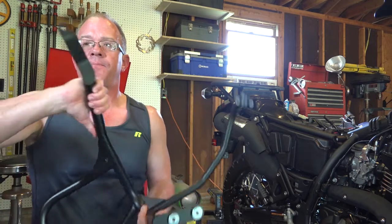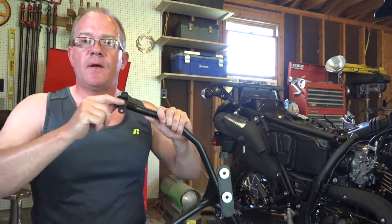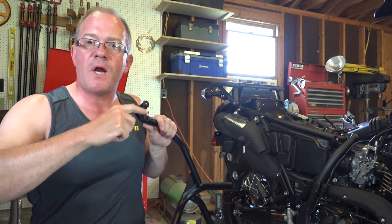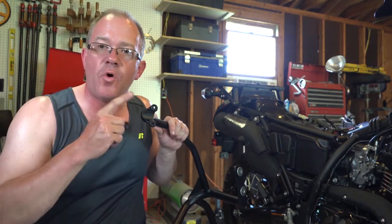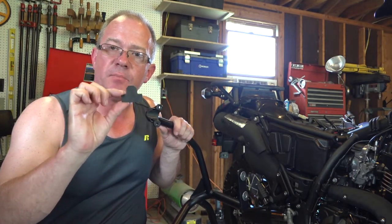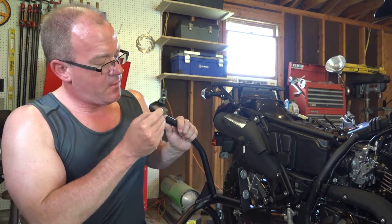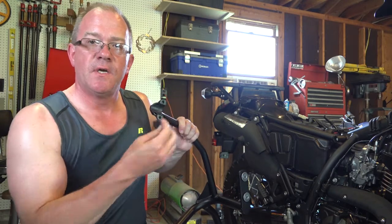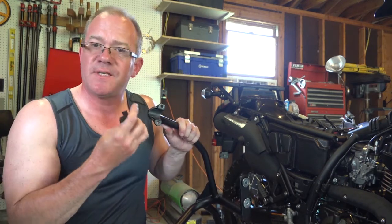At the other end there's a U-shaped bracket, and that's going to mount to the lower frame. Inside that U-shape on the bar itself, it's going to use this rubber pad that's supplied with the kit. It's got a crown to it that takes the shape of that surface. Just peel back that sticky material, apply it right to that surface, and that's going to give you a nice rubber mount on the bottom.